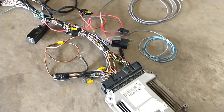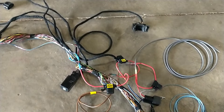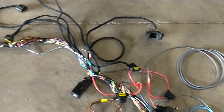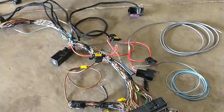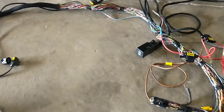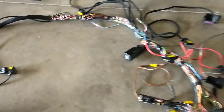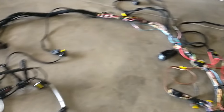The other interesting thing — it only has CAN bus to go to the OBD port. There is no K-line. I believe there is a pin you can splice to get K-line, but most everybody gets all their info off CAN on these newer ones anyway and they'll flash that way, so there's really no need to do a K-line — unless your scan gauge or something won't read CAN.